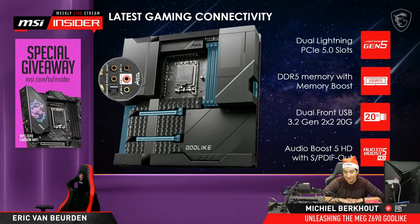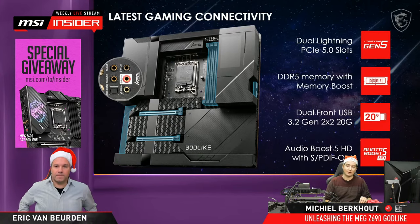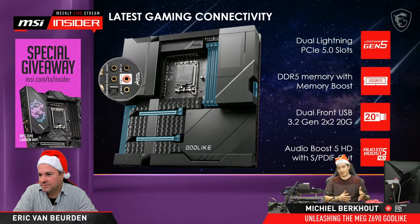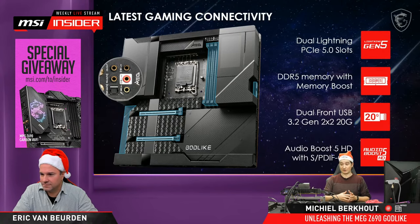Let me see. Then you get DDR5 memory support with memory boost technology. On this board, the DDR5 supports up to 6,666 megahertz. As you may notice, it's not the highest we have on any of our motherboards, because our Unify X and our Z690I Unify motherboards, so the Mini ITX one and our 2DIMM ATX Unify, can go even higher with official support for 6,800 megahertz. But that's of course because there are only 2DIMM boards and the Godlike is a 4DIMM board. 2DIMMs will give you a clearer memory signal, which allows for even higher clock speeds. But Unify X is really targeted at overclocking, and for Godlike, we really wanted to include those 4DIMM possibilities.